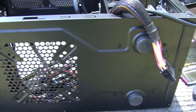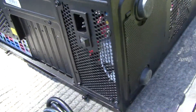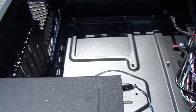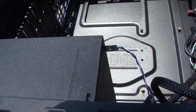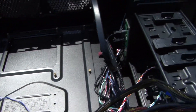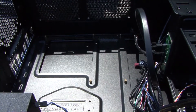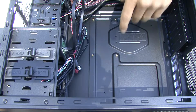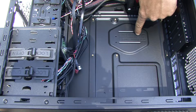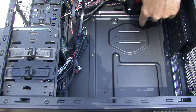The PSU is mounted with just a few screws in the back. I went with an 875-watt PSU since I'm going to be running a couple of video cards, an SSD, and probably three other hard drives. The PSU is already in and the mounts are set. On the back of the case it shows you which holes to fill in for micro ATX or ATX.